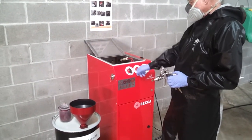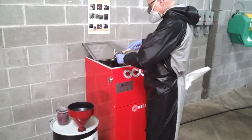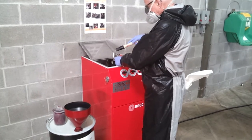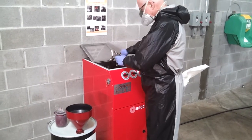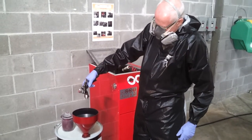Using the flow brush power pistol selection switch, turn it to flow brush. Pre-rinse the spray gun with used solvent from the flow brush and pour the pre-rinse into the approved waste container. Be sure to trigger the gun over the container.